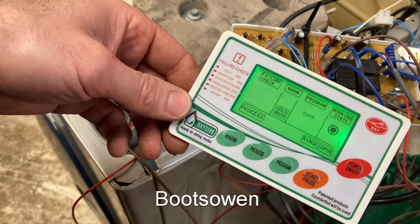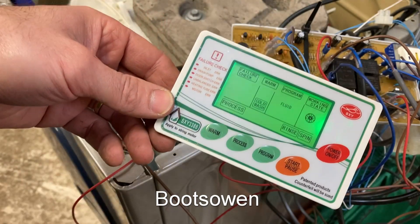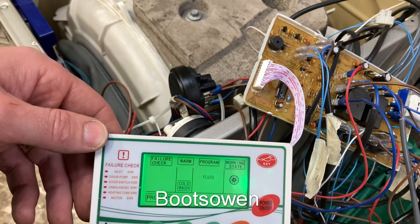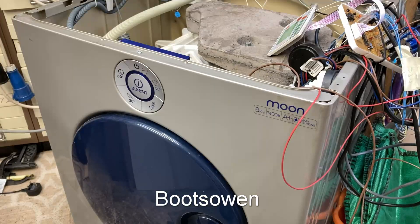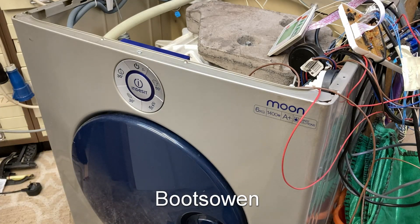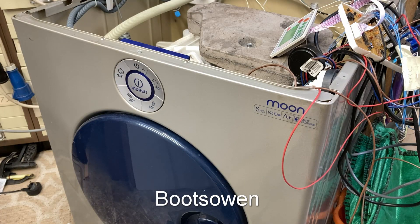There's a door switch error. Power on, close the door. Oh, very strange - it's taking on water! That's a win. I wonder will the pressure switch work to stop it - it might take on an awful lot of water. It's on cold, so it doesn't matter. It's filling through the gray hose which is the one on top. It sounds like it's taking a lot of water. The door is locked. It's got an extreme amount of water in it now. I'd say if only this Indesit had had a glass door.